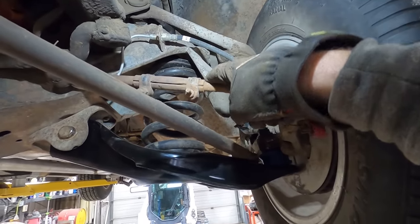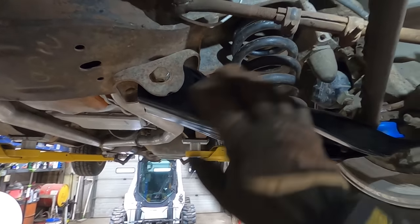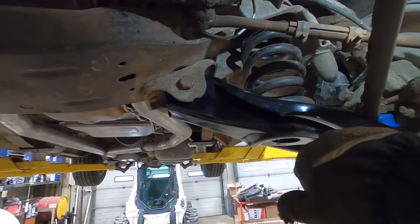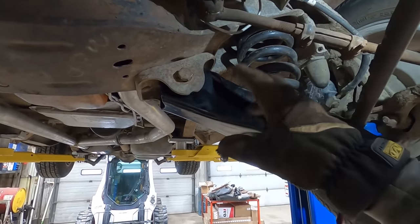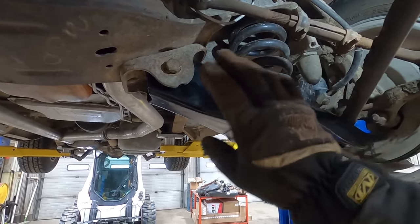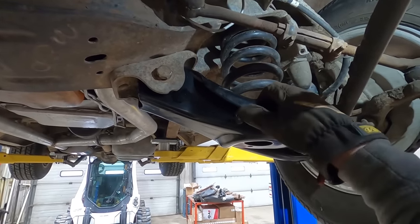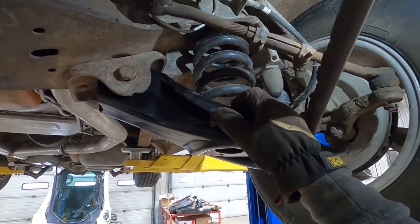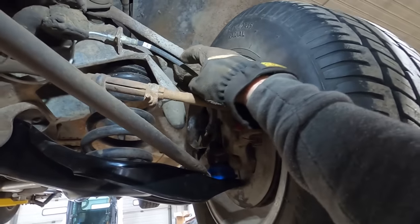You definitely don't want to heat a spring. That is the biggest hack move ever to lower a vehicle. Don't heat springs, because you never get the heat the same left to right. It screws up the spring rate. They ride rough. They bounce around. They go bing, bang, boing. No. Say no to heating coils. I'd rather you ran Craigers before you heated coils. Absolute biggest hack move in the book. Probably. It's right up there anyway. Right up there with cutting bump stops off.